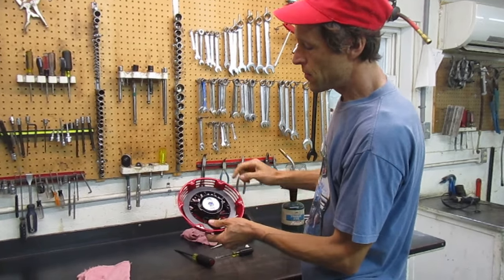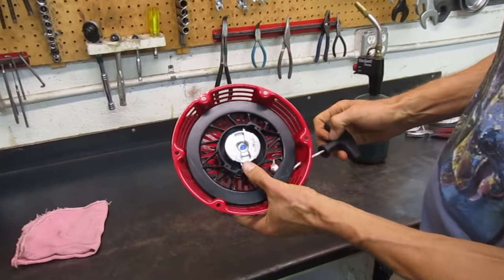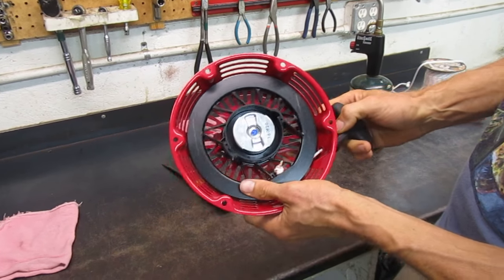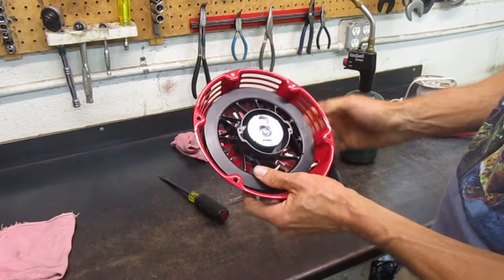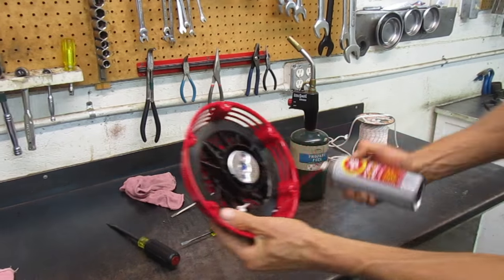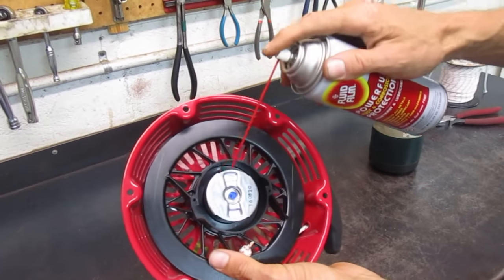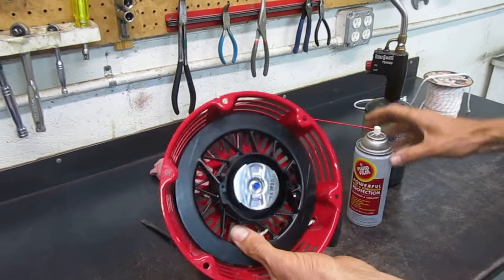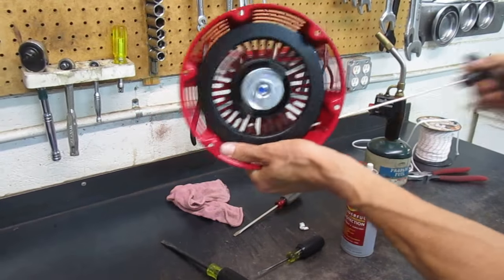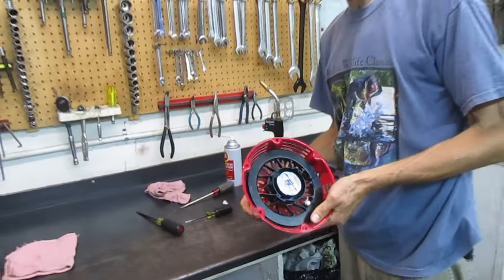A little lubricant around the moving parts usually helps. If you've got the kind of rewind starter with little jaws that jump out, it's not a good idea to get lubricant right on those jaws — those are what engage with the flywheel to start the motor, and they rely on friction to kick out. If I was going to spray lubricant on this starter, I'd try to get it in behind here to lubricate the spring, not where the jaws are. Spray it in there, hold the rewind on its side, and work it in and out to work that lubricant down into the spring. That's rewind starter 101 — thanks for watching.